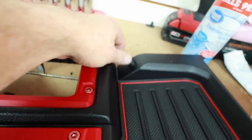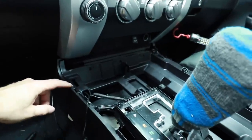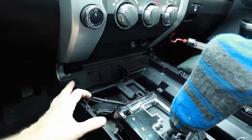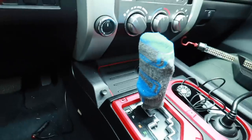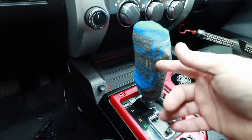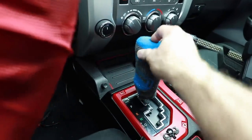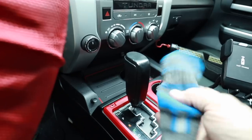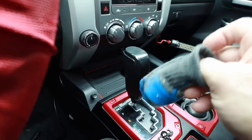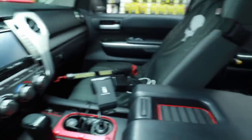With the sub being in, we need a sub knob. Fernando came up with a great place to mount it here in the center console next to where the gear shifter is, which makes it really nice. We ran the control wire here next to it. To get it in there, there's a little bit of trimming you have to do in this section to get it to sit flush, but there are no panel clips or anything that get removed. For protecting the interior during install, we use a children's sock along with a steering wheel cover. Underneath the steering wheel is leather or shiny plastic — we don't want to scratch those. Two children's socks, one inside the other, slip them over the wheel and that'll keep it from getting damaged.